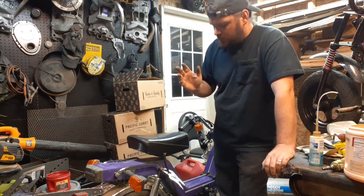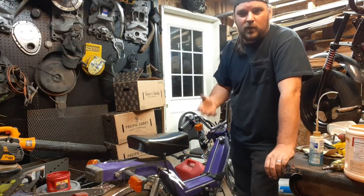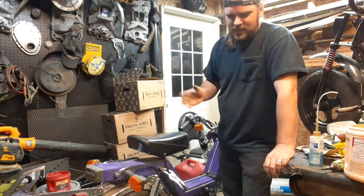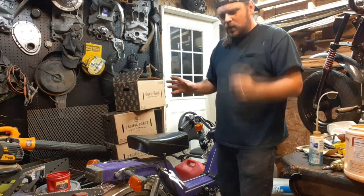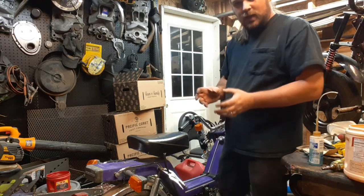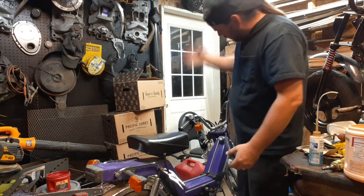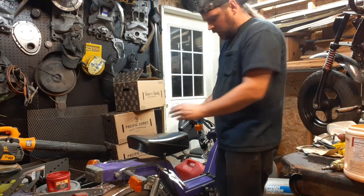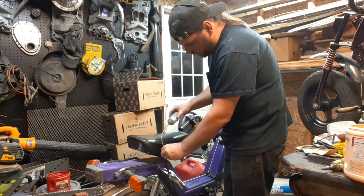So today, this morning, I took the engine completely out and took it apart as far as I could without the special tools you need. And I did a compression test. It has like 140 PSI compression. Everything seemed good. I took the carburetor off again and just verified that it was clean, and it's clean. So then I took apart the headlight, you know, and I found that the wires were... Everything looked fine, but I just wanted to try it.